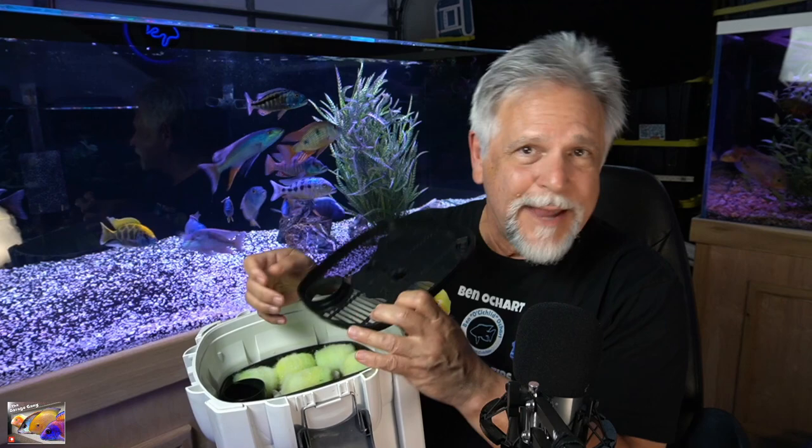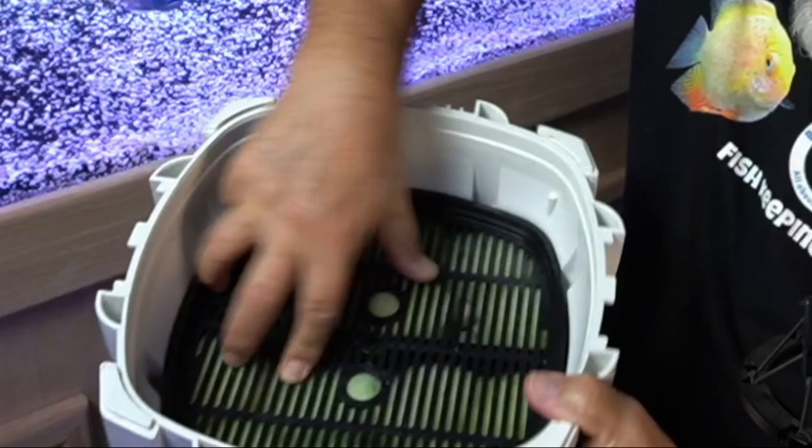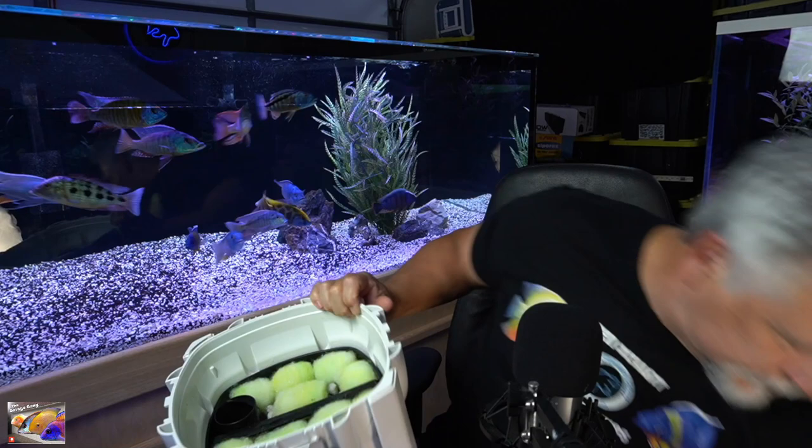Let's go inside this canister. We're going to go backwards. Of course you have this little shield on the top, and I want you to notice that it's all rock solid - there's no movement here. That's because I didn't over-stuff the baskets. If you over-stuff the baskets and they're not sitting right, you're going to get a rattle. If they're set up right, they work great.